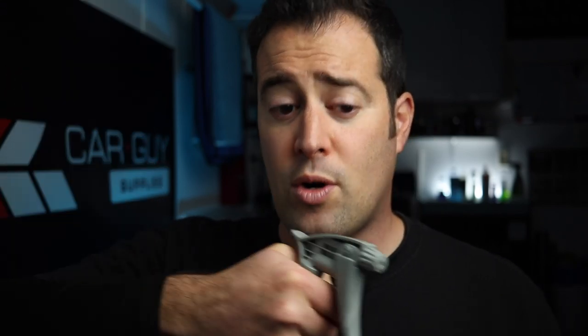You don't want to over-saturate upholstery because you can run into a whole other world of problems. I know that because I've done it — I've tried saturating the seat with cleaner and pulling it up with the extractor. It looks good at first and then about 10 minutes later you will see those stains start to reappear. Now, you could use the tannin stain remover or fabric rinse in your extractor — it's actually designed to do that — or spray it onto the top surface and then use the extractor to neutralize the chemical. But sometimes the drink spill goes so deep into the foam that the more you saturate it the more it's going to wick up, so it's hard to tell if it's the chemical oxidizing or the drink spill wicking back to the surface.